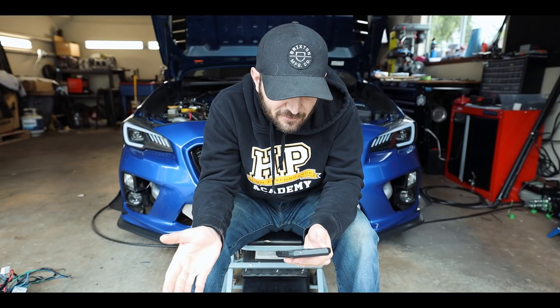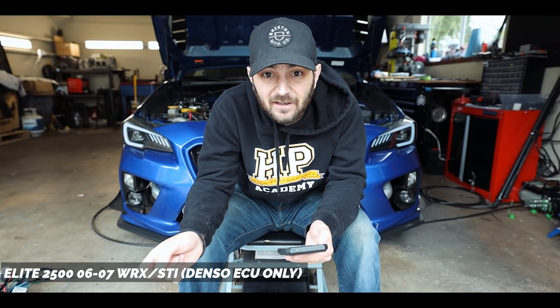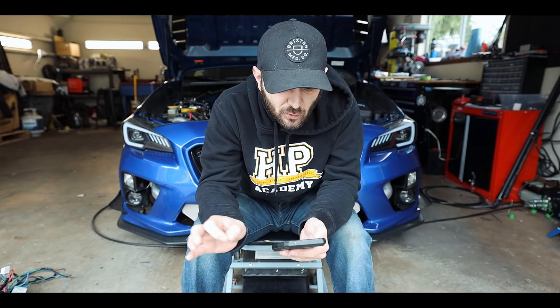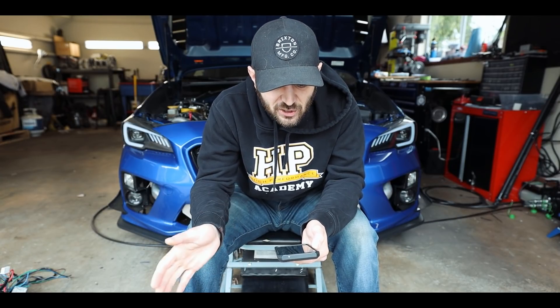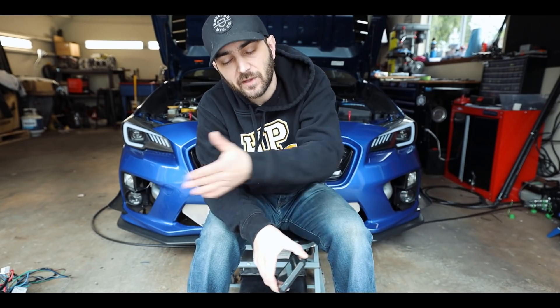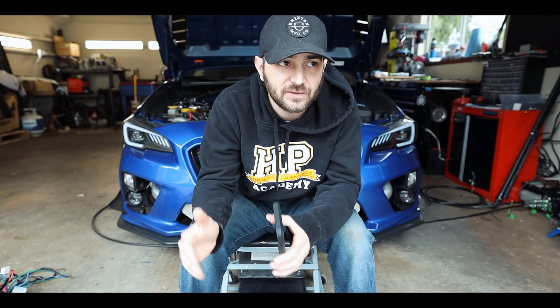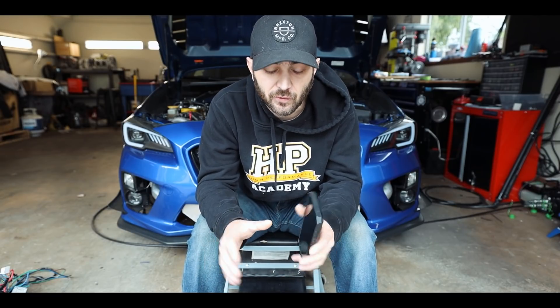Additional Haltech Subaru-supported options include: EJ25 2006–2007 WRX (Denso only), 2006–2007 WRX STI (Denso only), and EJ25 2006–2010 WRX. There were notable changes from 2005 to 2006 WRXs — up until 2005 all WRXs were 2-liter, then they swapped to the 2.5-liter. The STI had changes from '05 to '06 to '07 as well, so ECU year ranges may vary slightly depending on which changes were integrated.